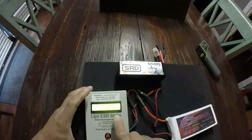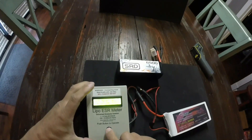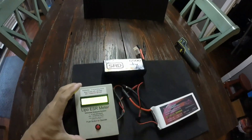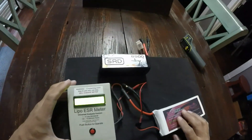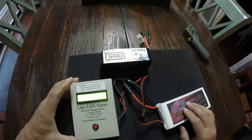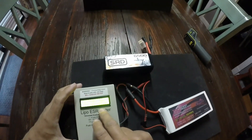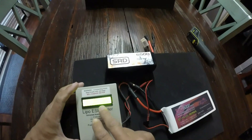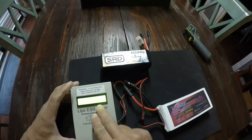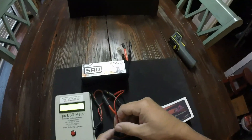1.4 — it's getting worse as it goes — 163 amps, 27C still. And the last cell: 1.36, 27C, 165 amps. This battery can obviously put out more than 165 amps — I've run over 500 amps on my Limitless with the 1100 in it — but this gives you a comparison. I use this as a tool to see what my IR is and how the cells are doing. If this drops to 150, you know the cells are getting weaker and it's time to start replacing them.